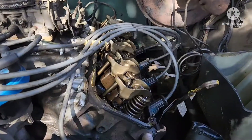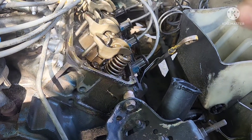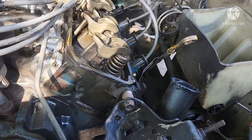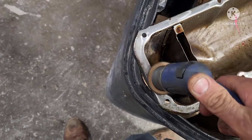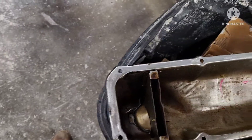It could be the quality of the gasket, but it's usually just over-torquing. So we'll clean this off and see what we can do — clean off the surface a little bit. I'll put some of that weather adhesive off there and scrub on it. Here I'm using a buff wheel to get any residual weather stripping gasket off so we can get the new gasket into place and stick it down with new stuff.